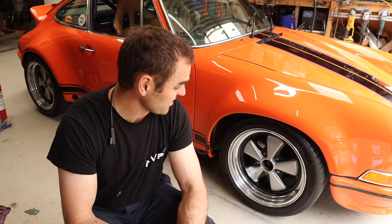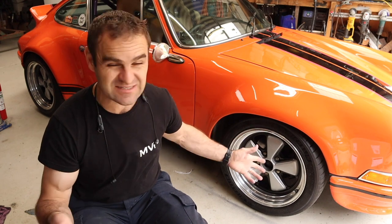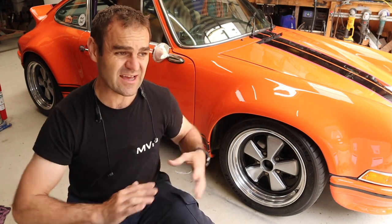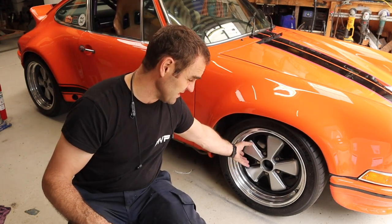That actually did an OK job — they're probably as good as they were before, or close to it. They weren't amazing before anyway. I'm pretty sure I went through the anodizing because the polish going black tells me it's gone through. There's no anodizing left, so these are going to stain and turn ugly. Going forward I'll probably repaint them silver, at least the edge. I still like the RSR finish — silver center with the black backing — but for the time being they'll do the job.